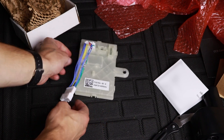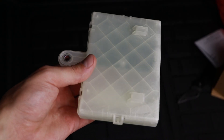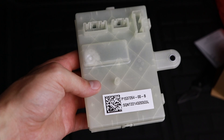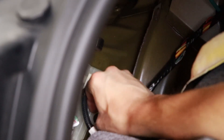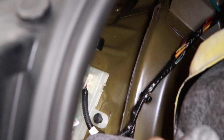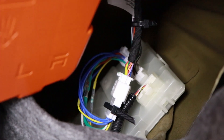If you have a Tesla built after October 2021, odds are you have the right wiring harness and just need to swap the ECU. Once mine was ready, I started installing it back — connect all three connectors, slide it to the left into the car, and screw the bolt back on. Because I'm using the wiring adapter, it was a bit loose, so I used some zip ties to keep everything contained.